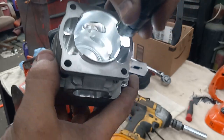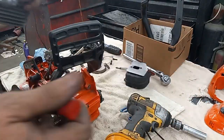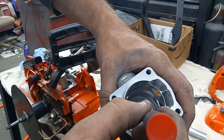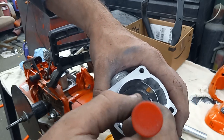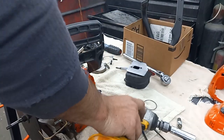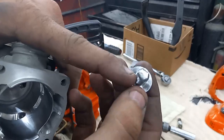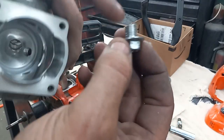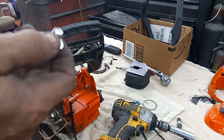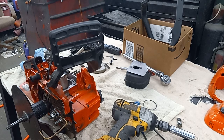See that compression release? There are almost four threads. There's a big lip down in here — see that step right there? That's a big step, and I don't like that. That's a cavity where you can bleed off some compression. So what I do is I get a bolt and you have to index it and match it to the chamber. I had to chuck this up in the lathe because I over-indexed it and actually had to cut some of the head back to get my depth right. Typically I wouldn't bother, but the hardware store charges $3 apiece for these bolts, so I wanted to get the most out of my $3 bolt.